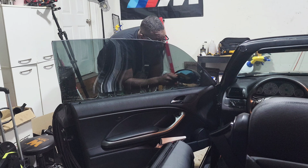And then squeegee the outside too, like they did, right? Except they weren't really using a squeegee. Oh man, that glides when you do the outside, see? I didn't know that. But now the fingers are beginning to rear their ugly head, just like I was saying. The fingers are beginning to show, right? So what they recommend is that you shrink the tint. So that's what we're gonna do. Let's shrink this tint. This is gonna be a practice piece.